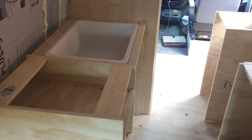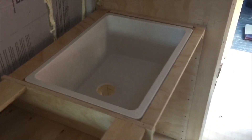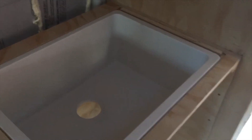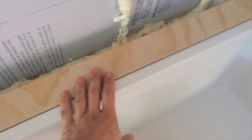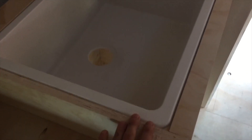I have finished framing up the kitchen. As you can see we've got our sink sitting nicely in position so that'll get installed later. Because of the amount of room I ended up changing how it was originally going to get stuck into position. Usually these sinks have some clamps underneath but I really just don't have that much room here or in front to pull that off. So instead I have recessed a channel all the way around in some plywood and that allows this to sit flush with the top of the plywood. So this is an undermounted sink and our bench top will come in and sit over the edge.